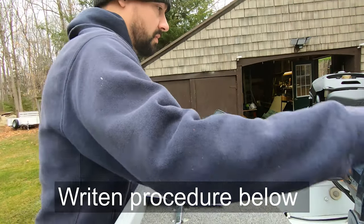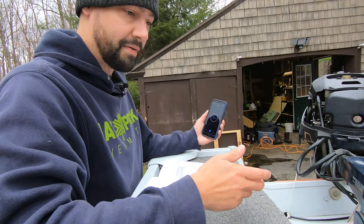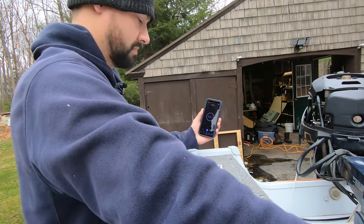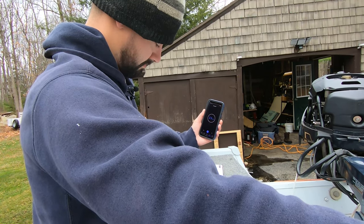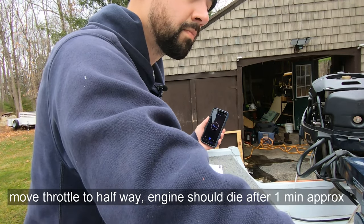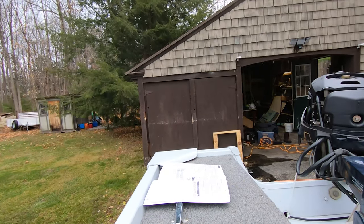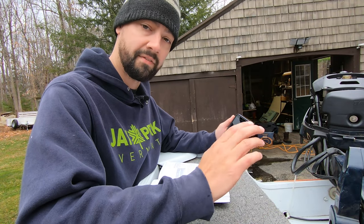Per Evinrude, depending on your controller, advance the grip throttle halfway - so that's all the way off, that's all the way on - advance halfway. Start the motor. It runs at slow idle speed. After it runs for 15 seconds, move the throttle grip to idle position. There we go, got it to work - finally winterized it. I'll show you guys the actual halfway throttle position. Mine's kind of worn off so it's hard to see, but we got it winterized.